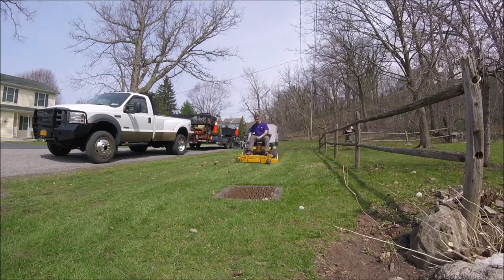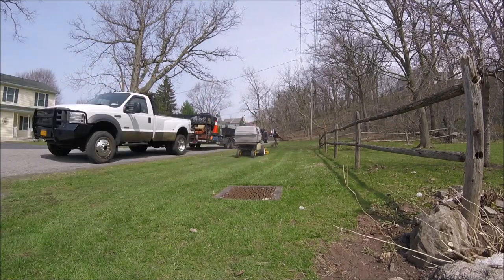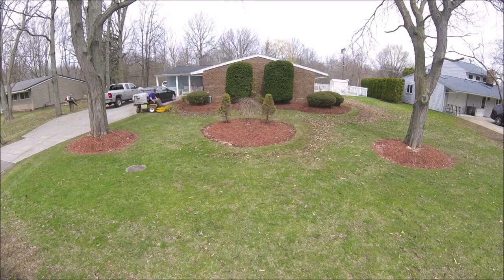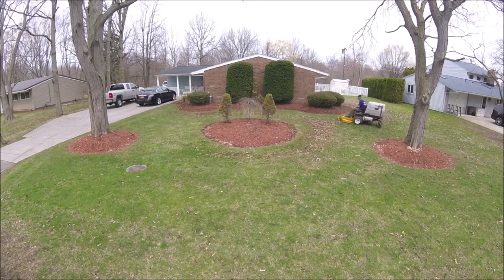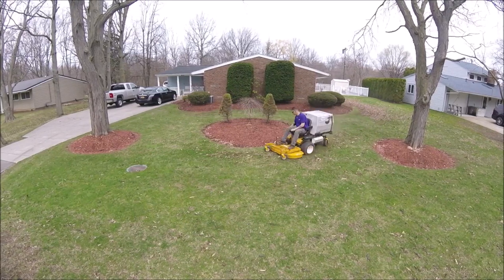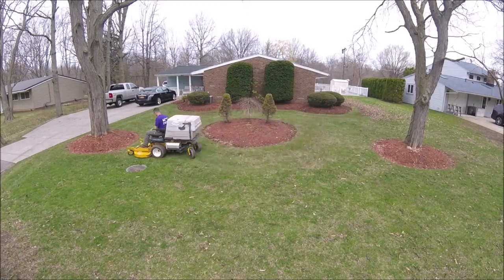There's wiring under the seat that was changed from when this went from an EFI motor to a regular carbureted engine, and took a lot of the computer stuff out of it. So there's a little bit of wiring left underneath there that was changed around, and the dealer had crimped it together with regular crimp connectors, which I'm not a fan of. So I think that is the issue. It seems that might be what's giving me the problem. I'm just going to pull them apart, solder the wires together, and use shrink tubing around it, and then it should be fixed for good and I'll never have that problem again.